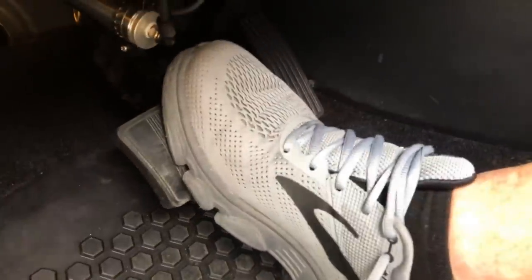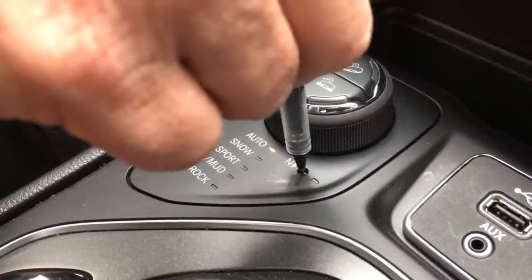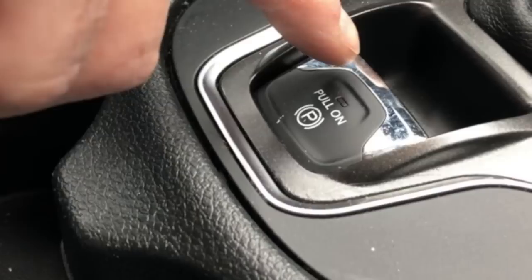Now I'm going to go through the 19 steps of releasing the transmission so that the vehicle will flat tow. It should be fairly simple, but I'm going to read each one as this is the first time. Eventually I'll make a cheat sheet and put it in the visor. First, vehicle must be at a complete stop. Turn the engine off, then turn the ignition to run mode but don't start the engine. Press and hold the brake pedal. Shift the transmission into neutral, then use a ballpoint pen to push in the recess button next to the neutral setting on the console until the red light stays on. Start the engine, release the parking brake, shift into reverse, release the brake for five seconds to verify no movement. Put the transmission back into neutral, apply the parking brake, shift into park, and turn the engine off. Make sure tow bars are attached. Turn ignition back to run mode without starting the engine, press and hold the brake pedal, release the brake pedal, and turn the vehicle off. We should be good to go for flat towing.